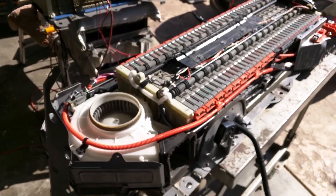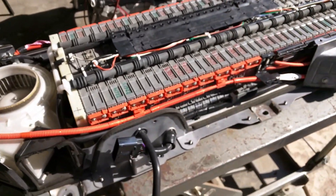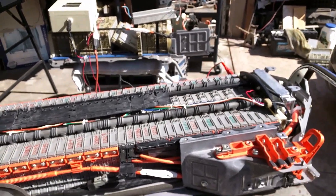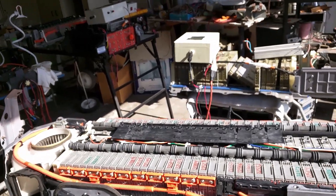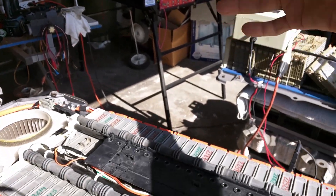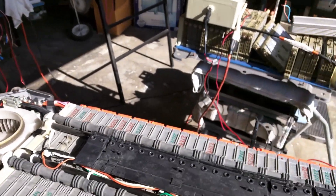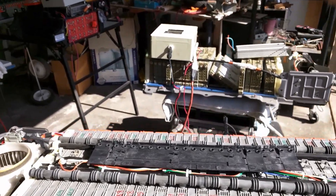So now I will take you over to the bench and show you. This is the Yukon hybrid battery as it sits inside the car. The left side is the driver side and the right side is the co-passenger side, and the driver is sitting behind here on this side. You have to charge on this side and not on this side, and you have to start charging in two halves.